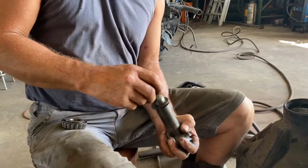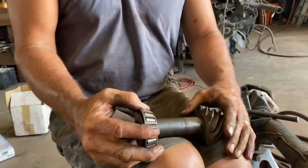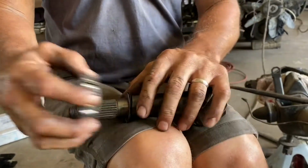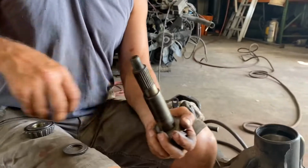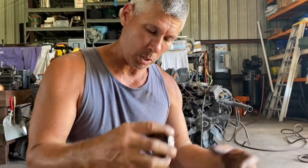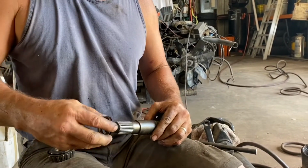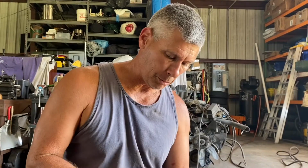So when you torque the nut on the yoke down, you're torquing this outer bearing up against the inner bearing and race, and it makes a solid stop up against this shim stack. And what you're trying to do is get the proper preload on these bearings. They can't be loose. They have to have a little bit of preload, and they can't be over tight. So the manufacturer says that it needs to have, for the sake of argument, as a general rule, 20 inch-pounds of rotational force. I'll look the spec up to be exact, but that's a good rule of thumb for most axles.